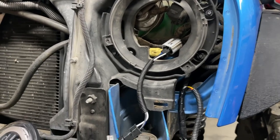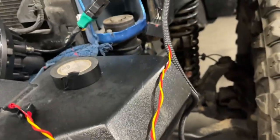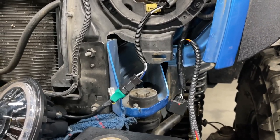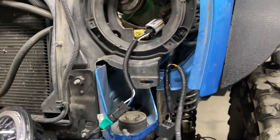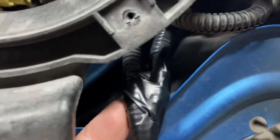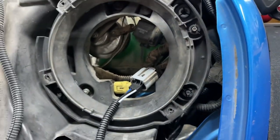So far this kit has been awesome. We've really liked everything we've seen. All the wiring, everything provided is pretty much everything you need to make this work, other than a little bit of tape and soldering — which if you don't have that, you probably don't want to hook up the halo wiring anyway. The normal headlight part is awesome. And there you go — finished product. Nice and taped up where the split joint is. Pretty waterproof connection.